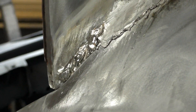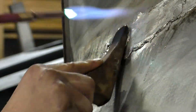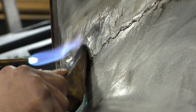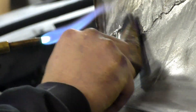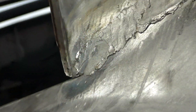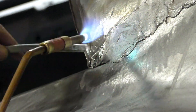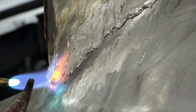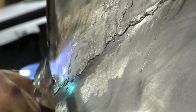Sometimes this is how you've got to work. As far as working on the angle, you might have to adjust your torch tip because that determines how fast it's heating up the lead. If you sit there and your lead's getting way too runny, you might have to lower your torch tip down and reduce the heat input, or come off of it faster. It's kind of like welding in the sense that everyone does welding different — travel speed for one person is different for another on a TIG weld. Same thing with the lead work. How fast you're putting the heat in there and how fast you can add filler material determines how hot your torch tip's going to be. So play around with it — you'll get it.